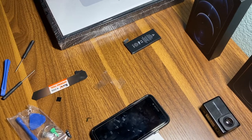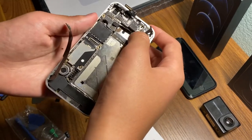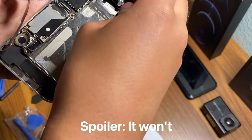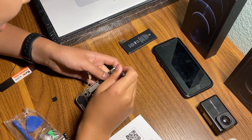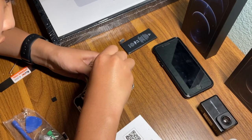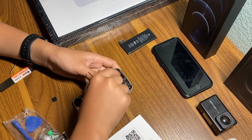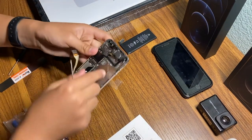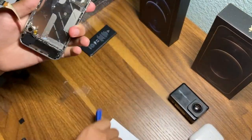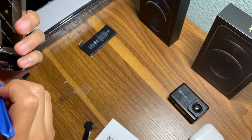Let's switch camera angles because my phone is running out of battery, so I need to connect it to the charger. I have removed the final screw, and now the logic board should just come right out. There's actually a random piece of black tape for whatever reason, and under there is another screw, so we need to get that out of the way before we remove the logic board. Now the logic board just comes right out. So let's move on to the speaker assembly and the 30-pin connector. Unlike modern iPhones, the iPhone 4 actually has the charging port and the speaker assembly separate instead of being fused together as a single unit like what we have today.